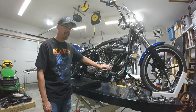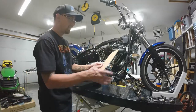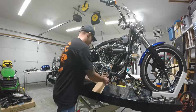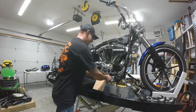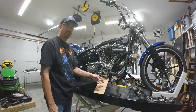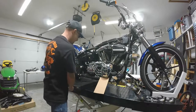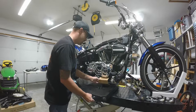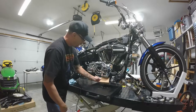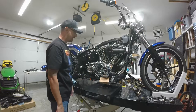So now we're going to focus on the cam chest. To help yourself, get a piece of cardboard and cut it, slide it, stuff it in under this guy kind of edge downward. What this is going to do is get all of the oil — instead of having it run underneath the bike — it's going to force it into the pan that you're using. Just like so. Now we're going to break these free and remove this cover.